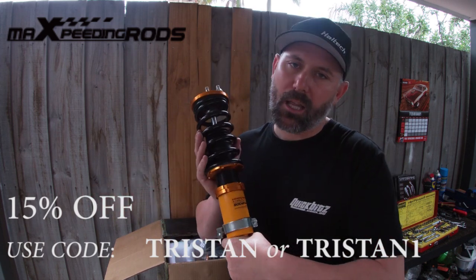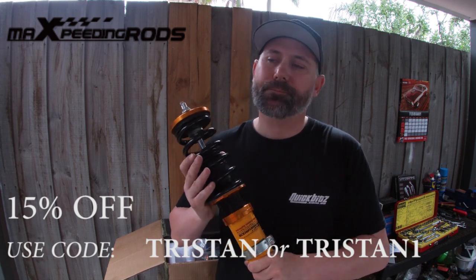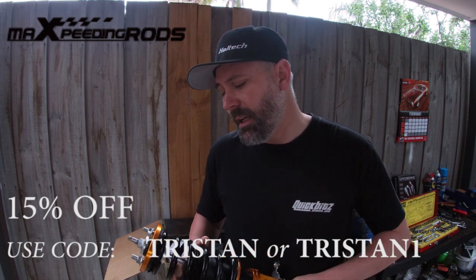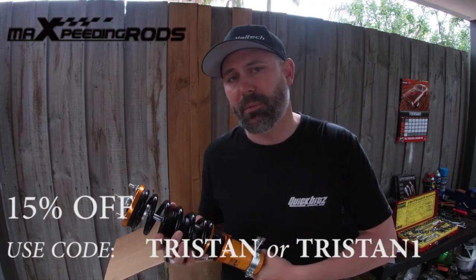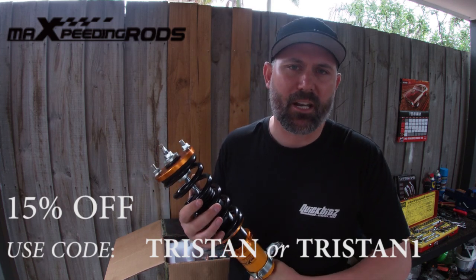But we're here to talk about coilovers, and it's the same thing. If these blow out after 2 or 3 years and a few track days, they only cost you a couple of $100 rather than a couple of $1,000. The downside is you can't get them re-gassed or resealed. At least I don't think you can. Maybe there's people out there that could. But why would you bother for $300 or $400? You get a new set.